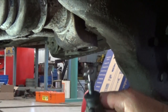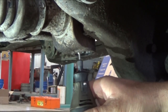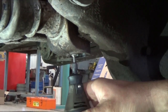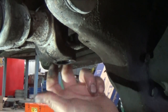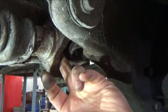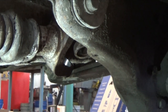The final cleaning on these yokes: I use a wire wheel on a die grinder and just go around inside where that snap ring goes — gets it all nice and clean. I also clean the yokes up so there's no dirt in them that can fall into those U-joint caps when putting it all back together. I take a wire brush and clean all the yokes so everything is clean. It just saves you the hassle of a failed U-joint.